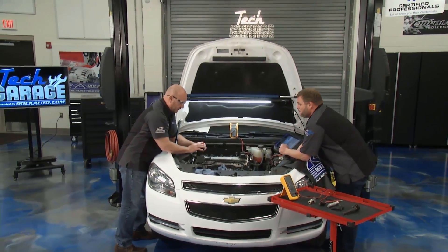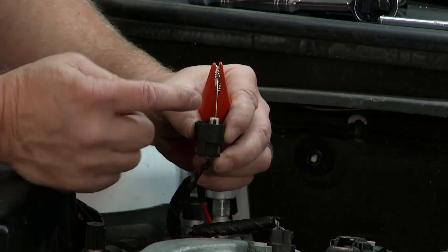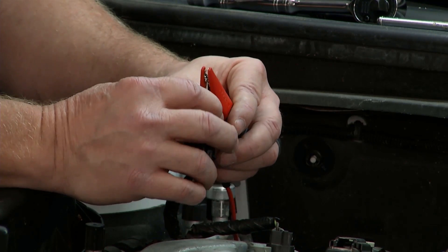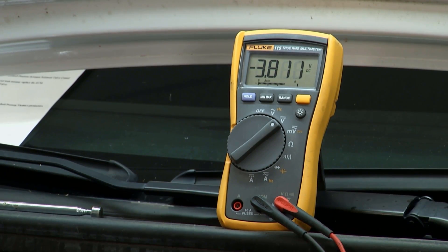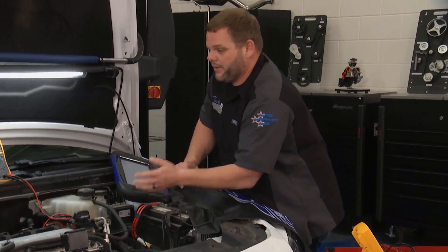To get this part of the test right, we had to hit the A post — the diagram online told us that. We put a needle down in the A post and we're connected. We should see some voltage there, and when Chase actuates it, that voltage should go away, telling us we're communicating.